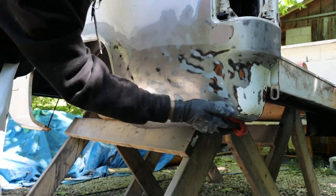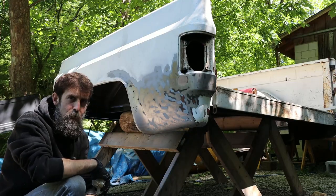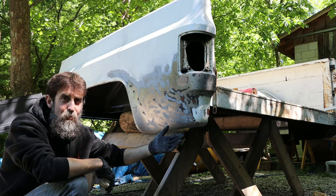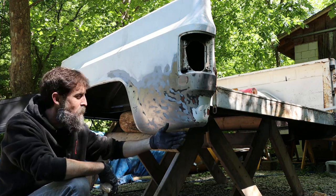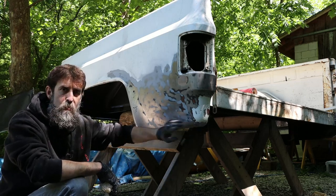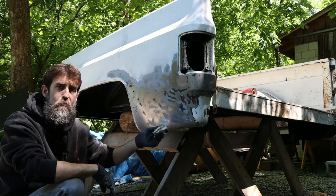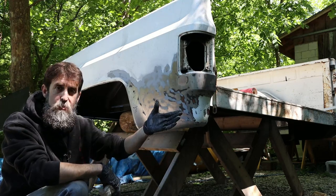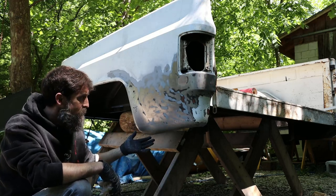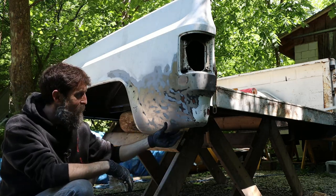That is my rust removal method — it works amazing. It's pretty much rust free, to the bottom of every rust pit. We didn't spend all the time in the world — probably five minutes on this, no joke — and all of the rust is gone. It would have cost more to use one piece of sandpaper than what it cost to use one paper towel soaked with the muriatic, wiping it back and forth for a few minutes. A little bit of baking soda once we're done to neutralize it. Dry it off really well so it doesn't immediately flash rust. This panel could be painted now and you'd be 100% confident that there is no rust in it.